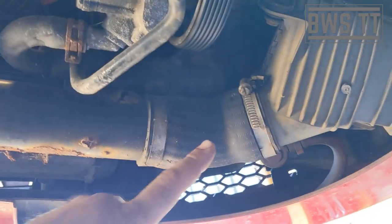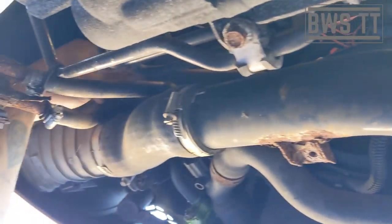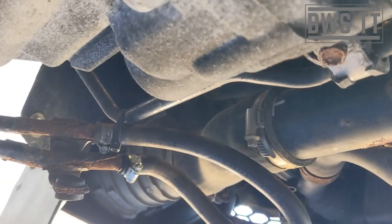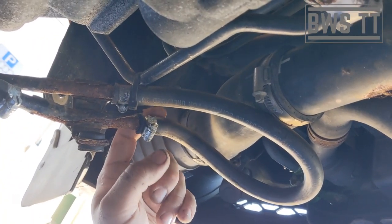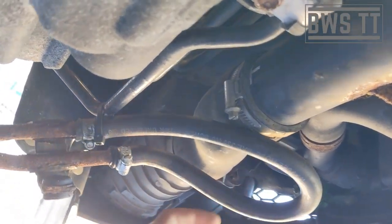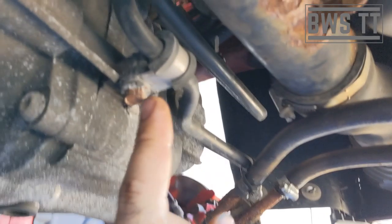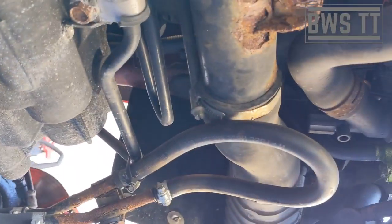So we're gonna wanna take the intercooler cross pipe off. Now normally the power steering line would go across here, but here's one I bodged earlier. About 3 or 4 years ago I did this fix for Gary, maybe 3 years. We looped the corroded pipe and just put a bit of flex in. Anyway, and then we're gonna wanna remove the fixings for the other power steering pipe, which are all up here.